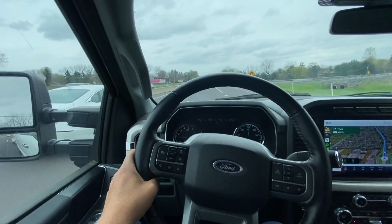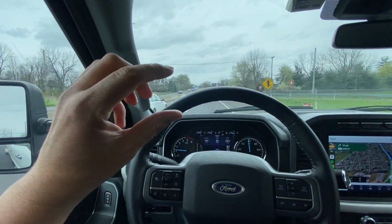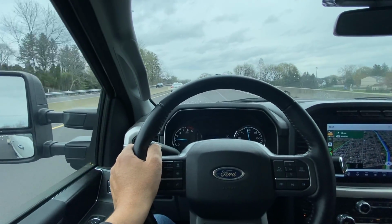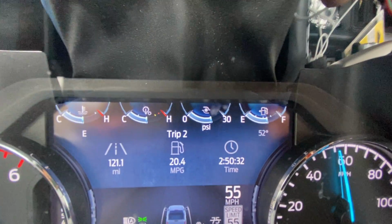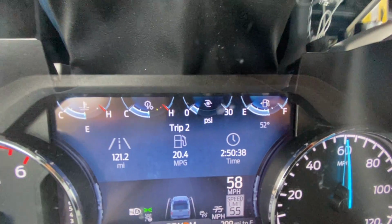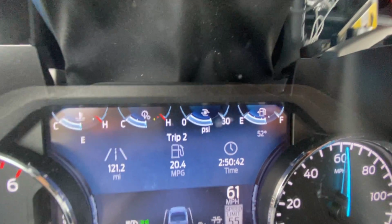Okay, I'm not trying to get too technical here. But again, your RPMs and your torque multiply together to generate your horsepower. And so if there's a massive horsepower requirement, your boost is going to be responsive to that horsepower requirement. It doesn't really have anything to do with your RPMs. Look at your boost gauge as essentially the power gauge, or the required power gauge.